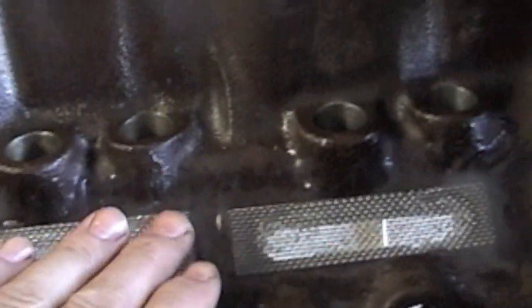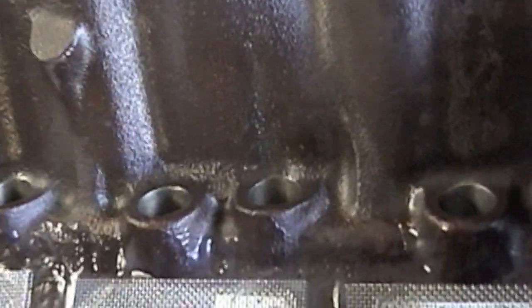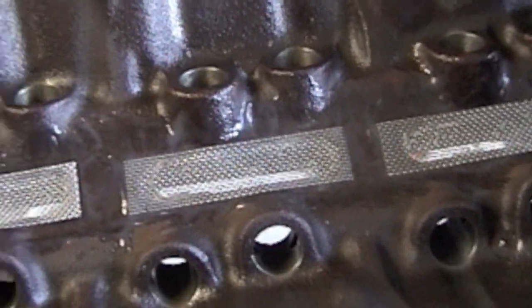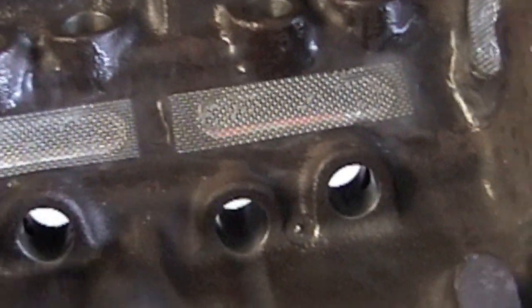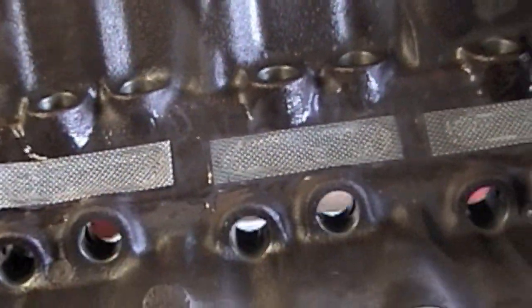What you can do is install an oil screen valley kit — it protects the valley so that if something breaks up here, all the parts can't go down into your crank. There's a screen here and screens on the sides. It's just epoxied in. Moroso makes a kit for about $25 — cheap insurance. Apply epoxy over it, and to hold it down while setting up, place some smaller diameter sockets on top with stacked sockets for weight. Do this before you take the block in because the epoxy will ooze down and drip on the cam bearings.